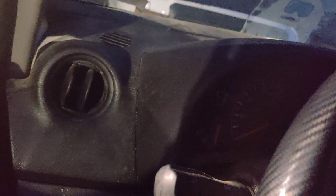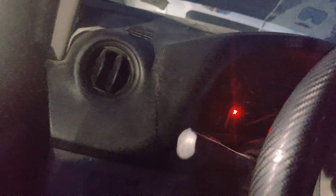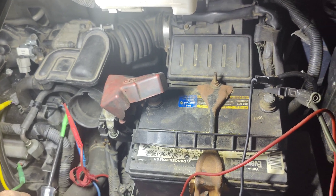We have nothing on the cam signal right now. This car - we shut it off and it's been running for about half an hour. Usually it starts back up. Okay, now we're not going to start. We might be making a bad contact. Let's see if we got a cam sensor code - no code. That's weird. Let's look and see what's going on up here. Let's put this back in - maybe that connector slid out.